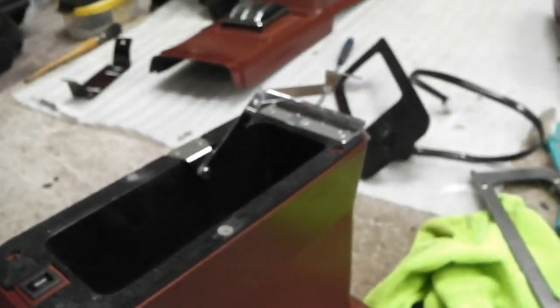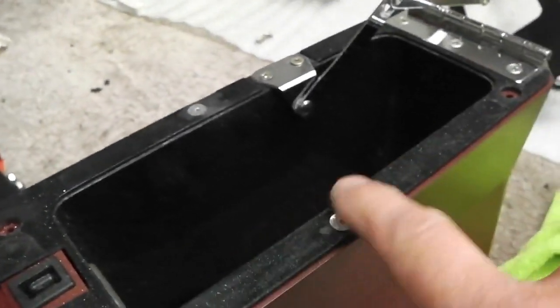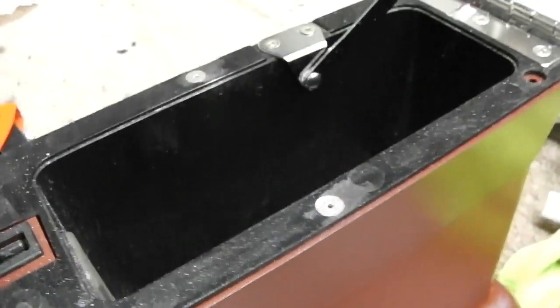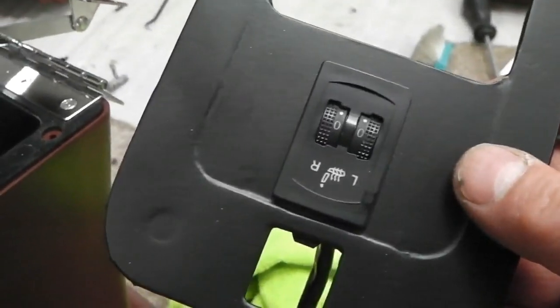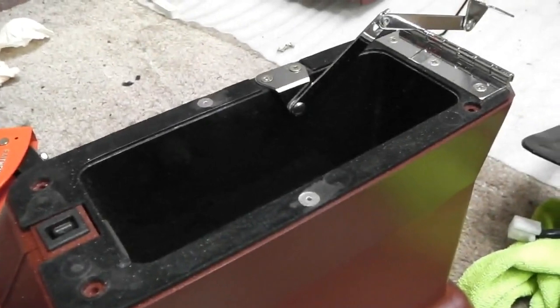Okay, rivet heads ground flush, still plenty of contact on those. Don't worry that you've got a little bit of scuff on the plastic surround because our trim piece goes over it. So we're all nicely secured. We'll blow this out of compressed air after. Trim piece on top now, that comes with a heated seat controls there. See how we've modified this plate to keep it nice and discreet all the time. I'll show you a few other features as well.